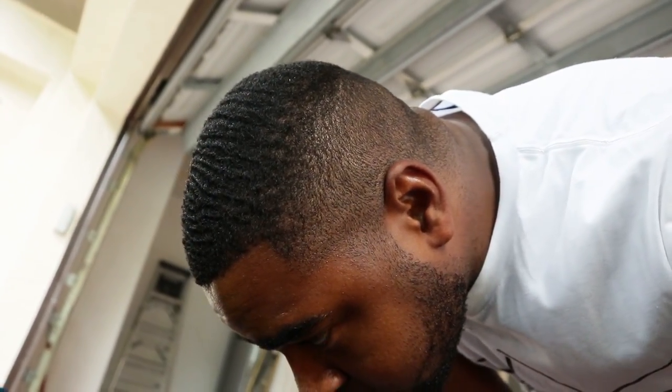You guys can see the sweat on my face. I think I'm just going to unbolt that 10mm that's holding the line in. It's dark outside and humid. I'm just going to unbolt that 10mm from the strut tower area so it'll be way easier for me to move everything up. Then you've got to go inside the car to remove the two 10mm bolts that are connected to the pedal. I'm having a brain fart, bro. It's too hot here in Florida to even think.